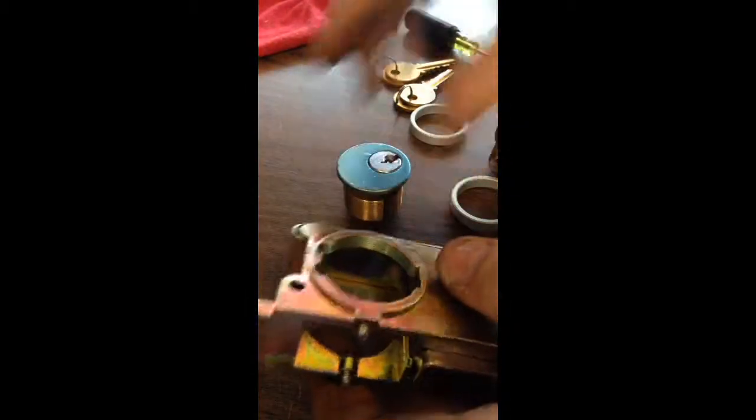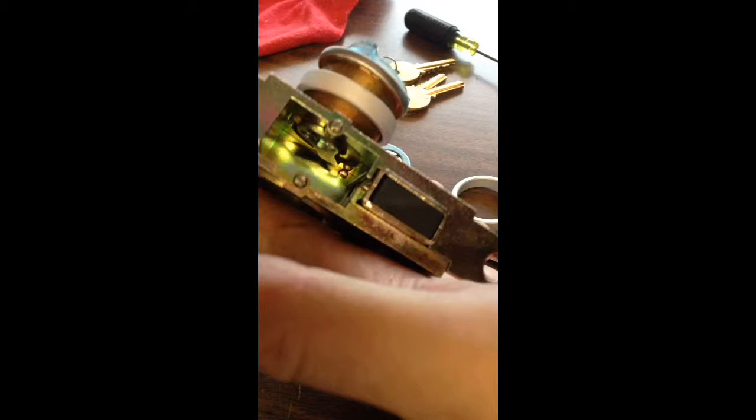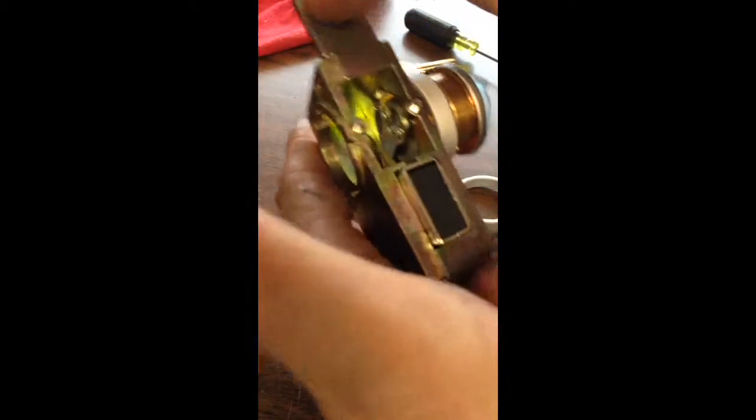Just for that reason they wear out — the cylinders wear out, they give you problems. So this auction comes with spacer rings. You would take the 10 or so screws off the edge of the door that hold the full-length strip plate on, and remove it. Once it's off the door, you would take the two screws at the top and bottom of this out and put the new lock in.